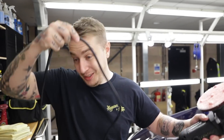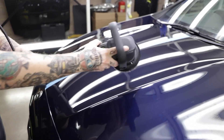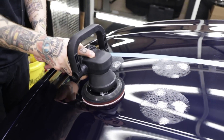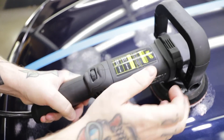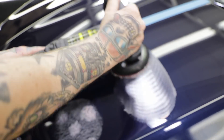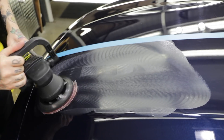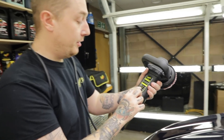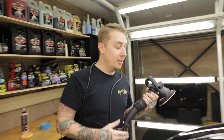Just like when you've seen machine polishing with the ultimate compound, there are a few rules to stick to. Cable over your shoulder so it doesn't rub on the paintwork. Stamp out the area you want to work — whenever you're compounding, try to reduce your work area so you're really concentrated on that section. Spread the product so it's nice and lightly primed. Now the surface is primed, set it to our swirl and defect removal speed, which is 4.8 to 5.8. Do your hashtag passes to get a nice even spread of product and cut through those swirls and scratches.